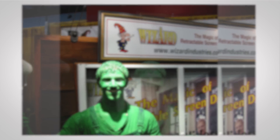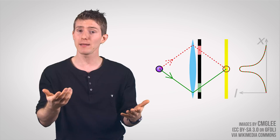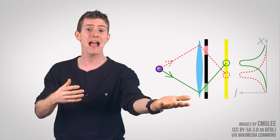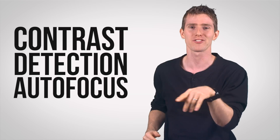In older cameras, the user would manually have to adjust the focus until both images came in line, but today software is utilized that matches up light intensity patterns based on peaks and valleys, allowing it to make a determination about whether the subject is back or out in front of proper focus. While phase detection works well on high-quality cameras with interchangeable lenses, the added cost and bulk doesn't always make it a feasible option, which by contrast brings us to contrast detection.